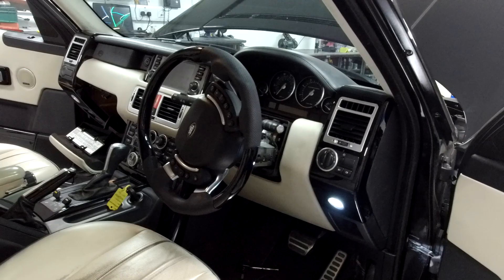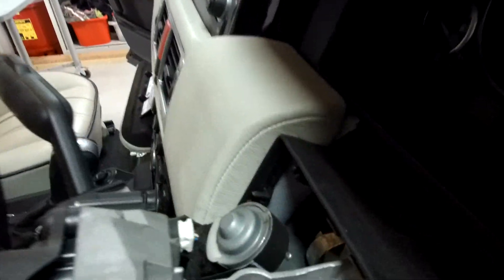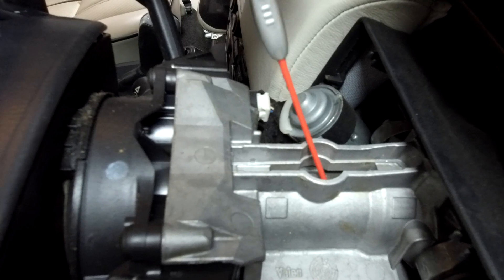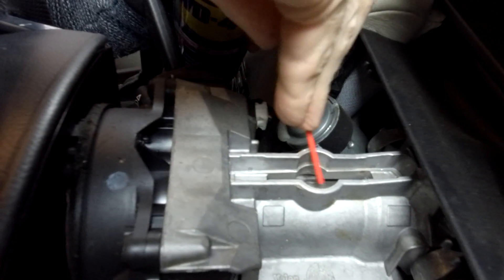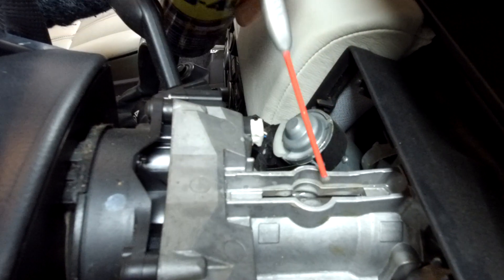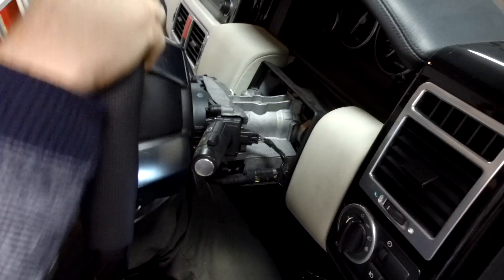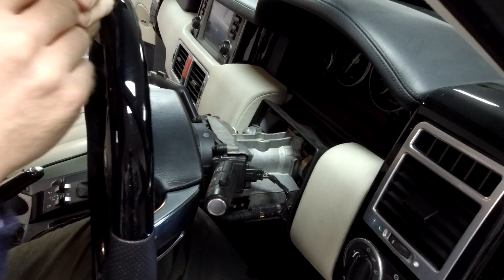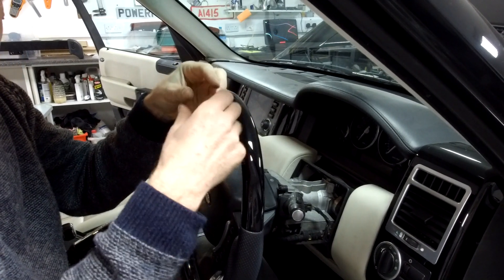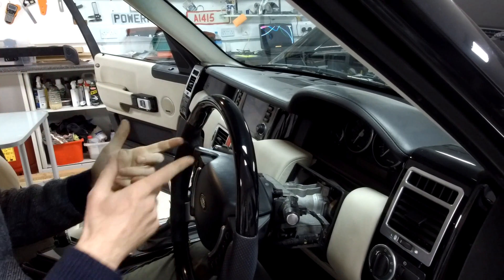There is a little trick you can do if you get stuck, and I'll tell you that in just a minute. Let me put some WD-40 on here — I'm going to squirt it down this side towards the locking mechanism. I'm doing this as a precaution. Craig at Camtech said he's done it on his car as a precaution because over time there's a mechanism that fires and is supposed to spring back, but it gets gummed up with grease and doesn't fire back.